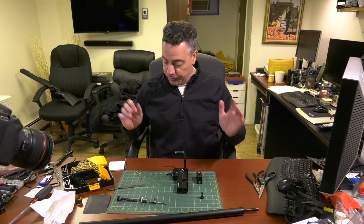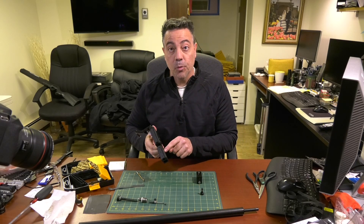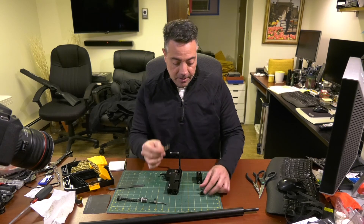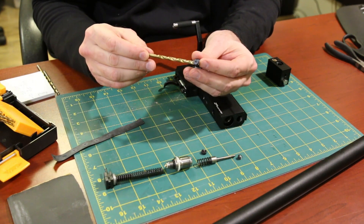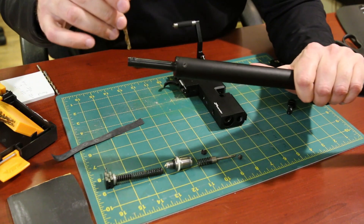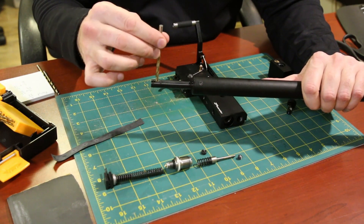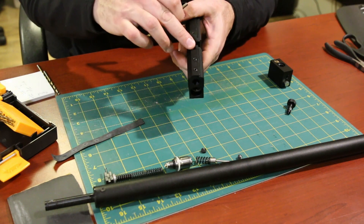At this point I have drilled out the barrel port, the power adjuster, and the transfer port inside the block to 3/16ths — basically I've made it one 32nd larger. Here is my 3/16ths bit — it now fits loosely and I sanded it to make it nice and smooth with no rough edges. Here is the barrel port — fits in there nice and smooth, straight, and I've sanded all the burrs and edges.